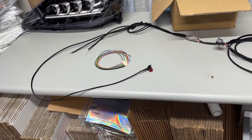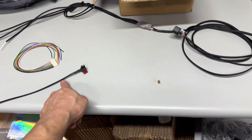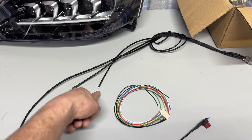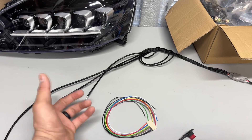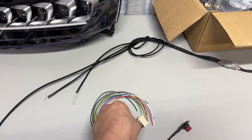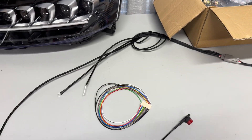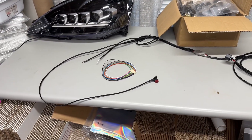Super simple — plug it into your flex fuel sensor, run it inside. You're going to need power, ground, and signal. This will work for any ECU because it's a very simple concept. For KPro, run it to the white wire. If you have this connector, you just clip the two together and you're ready to go. I'm going to run outside and show you how we did it on my car.